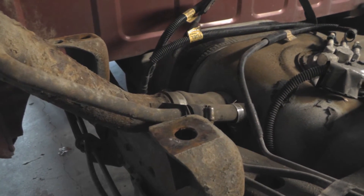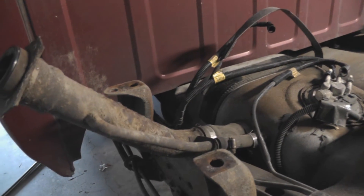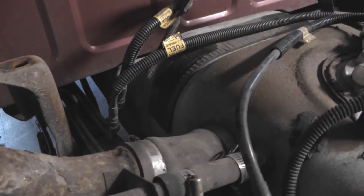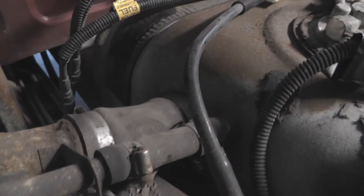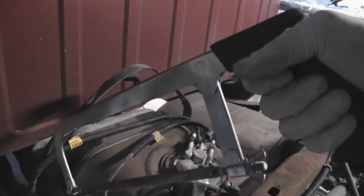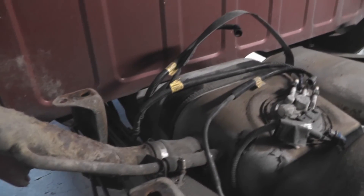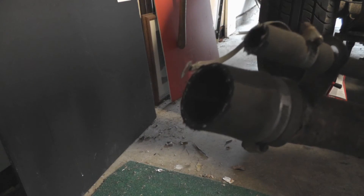I'm having a hell of a time trying to get this fuel filler neck to separate from the gas tank. It should just be a rubber hose held on with a couple clamps. I undid the clamps closest to the actual fuel tank and I'm pulling and pulling but can't seem to get it off. So I'm actually just going to cut through the clamps with a hacksaw, being very careful not to get any rubber bits into the fuel — because even though there isn't a lot of fuel left, I'd still like to use it in my car.